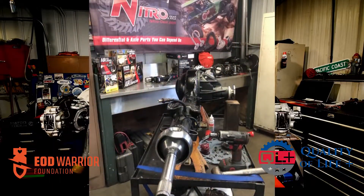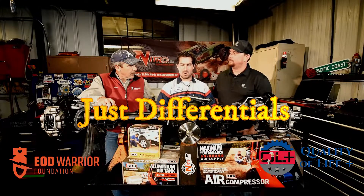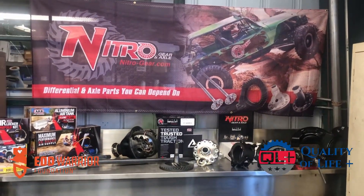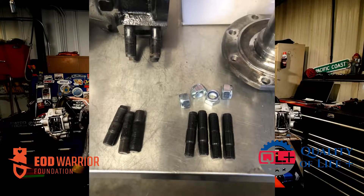The axles came from Just Differentials. These guys were able to supply us with all of the Nitro gear parts, the complete knuckle rebuild kits, and all the ARB components — those guys were stellar. These studs in the top of the knuckles that hold your steering arm are known to snap off, especially when you're doing some hardcore wheeling with oversized tires like 35 inches. So we went with an ARB hardened stud kit, and that should be pretty much the last time you ever have to mess with those.